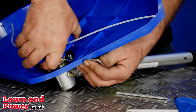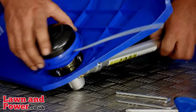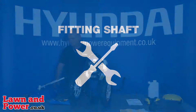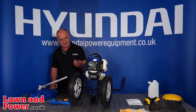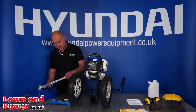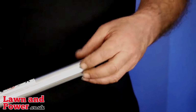Screw it down firmly till it stops, and then pull up the Allen key, and that's now ready for use. So the next step is to fit the head onto the engine. Remove this when you fit it to the engine, but plug it back on if you're going to store it away or disassemble it, and it'll stop any dirt going down into the shaft.